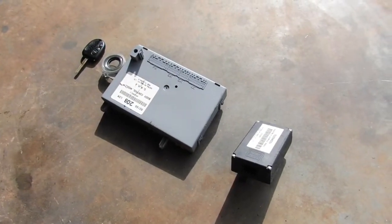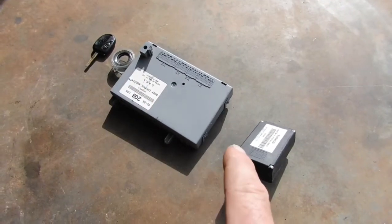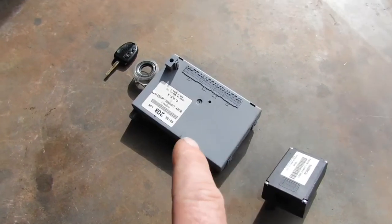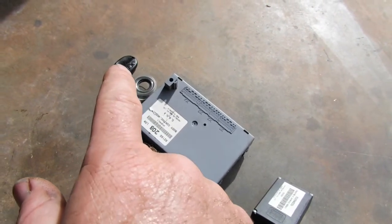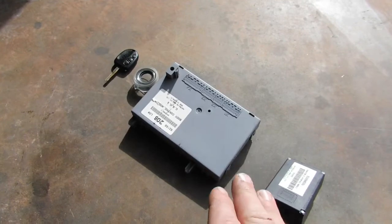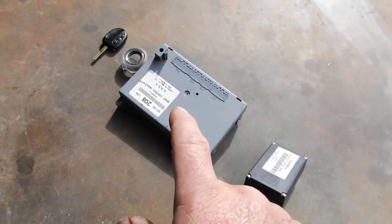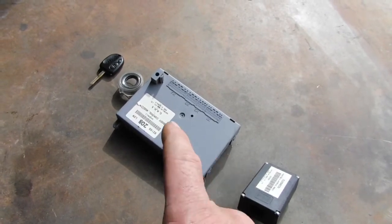For you guys out there that are swapping the V8 into the V6 body, these are a must-have item, and they must match and come out of one V8 vehicle the same model as yours to make your job easy. Powertrain interface module, body control module, little ring that goes around the key, and the key head. The key part itself you can change out to suit your locks, but the actual key head sends a signal to the ring, which sends a signal to this, which sends a signal to this, which makes it all work, and it all matches up. If you want it seamless, make sure you get all them matching out of a V8 car the same as what your V6 car is, and you'll have no problems. Just about to finish buttoning up the interior, so I'll show you quickly where these go, and I'll catch up with you on this one.